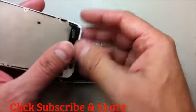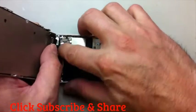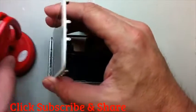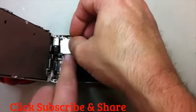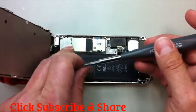When you do put this back in, you're going to want to be very careful. Go ahead and prop it up again the same way that we did when we removed it. Plug your connectors onto the logic board and then make sure they don't move around, because if they shift at all, you're going to end up getting stripes on your screen and you'll have to open the thing up and put it all back together again.